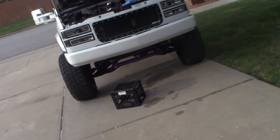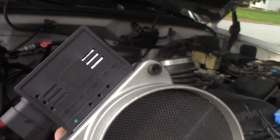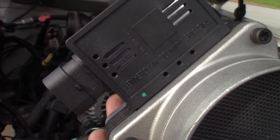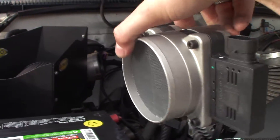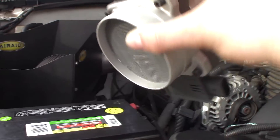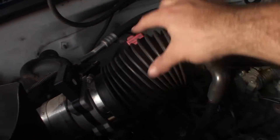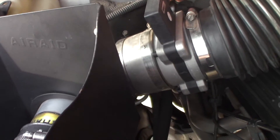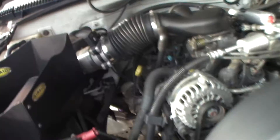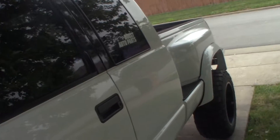Let's go ahead and get this thing installed back onto the truck. One thing to note is that you can put this on backwards. On the portion where you plug it in, it says 'this side facing the air cleaner,' so put it in with the screen facing the air cleaner. Now that everything's on, make sure you get everything plugged in nice and tight, get your clamps down nice and tight — you don't want a vacuum leak. Everything fits nice and factory just as it did before. We'll start her up and see what happens.